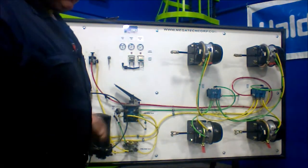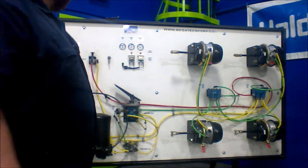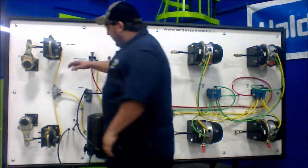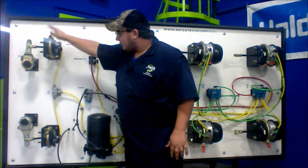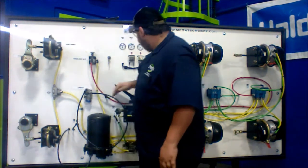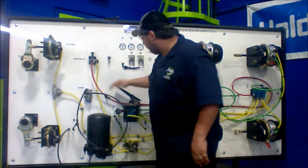Alright, so I've built up the air brakes on this display to about 100 pounds of air pressure. Here we have a slack adjuster that will be on the front. So you can see these move — you can go apply the brake and push the brake pedal.